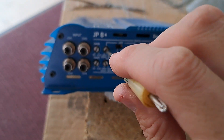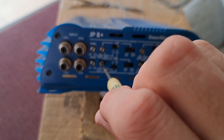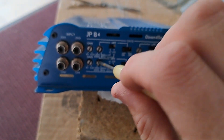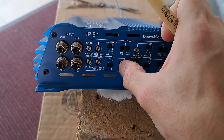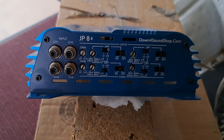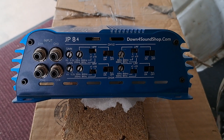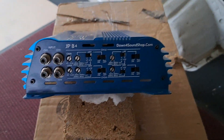That's it — it's that simple for the coaxial setup. You don't need to mess with anything else. You don't need to mess with the low pass. All you need to do is mess with the high pass filter just to cross that mid out, because the tweeter's already internally crossed with the inline cap that's on it. So you don't need to worry about that.